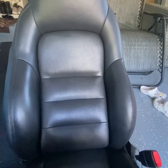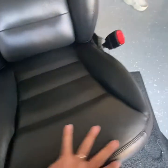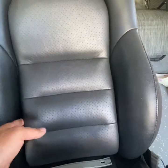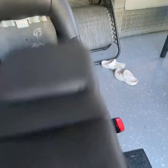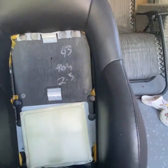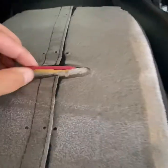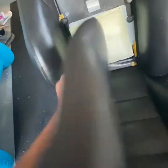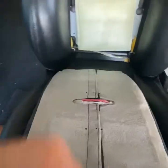Once you release the zippers, the two push clips, and that rope around the bottom cushion - these two push clips hold the middle section on. To remove this middle section, you're going to push up on the cushion just like that, then really muscle it and it comes right off in one piece. This tab and this tab is what really holds the cushion on - there's a bracket here and a bracket here.